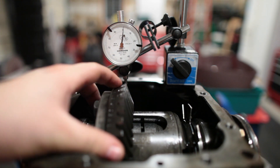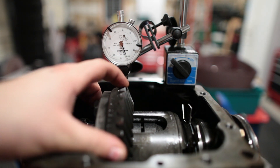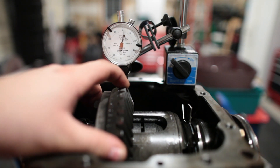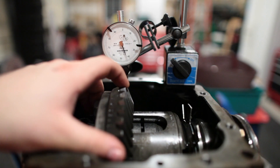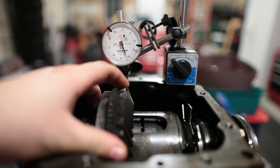When I rock the ring gear, I get between 1 and 43, so about 41 to 42 increments — that's .0041 to .0042 inches — which is within the specs I've found online.